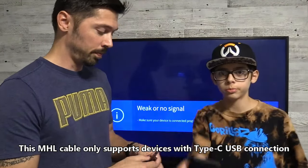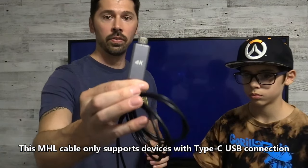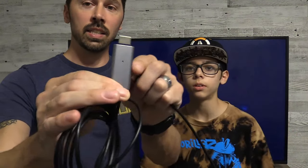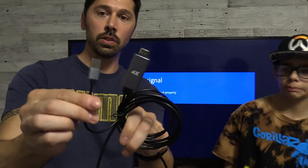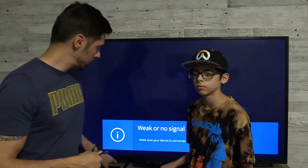Right now we're going to connect the S9 phone. On one side is the Type-C connection. On the other side you have an HDMI connection that supports up to 4K resolution. On this side of the HDMI connection you have an LED status light. We also have USB for power to charge your phone. You can use the USB connection on your TV, or if you don't have one available, you can use a USB connection on a power bank — a 5V 1A or 5V 2A connection. This one supports 1A and 2A as well.